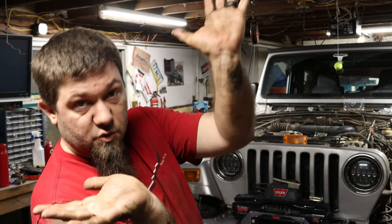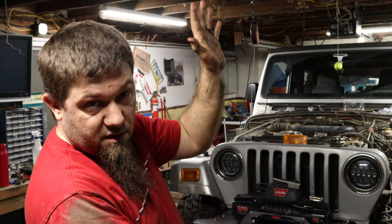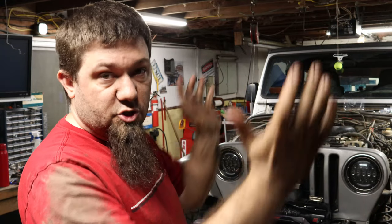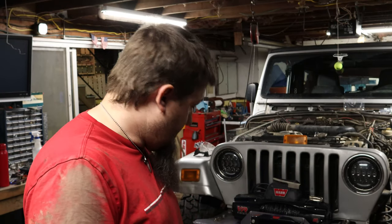I had to put the exhaust itself on a jack because the moment I got it loose the whole thing started to pivot - which was good, because as soon as I got it supported by the jack, the Y-pipe had pivoted forward. So like if this is the front of the Jeep, it pivoted that way, which basically tilted the oil pan - which is now resting on the Y-pipe - just enough and lowered it just enough that I was able to get it past the bell housing on the transmission. And there it is - it's out of the Jeep!